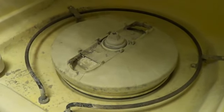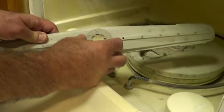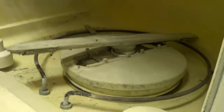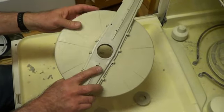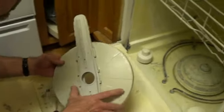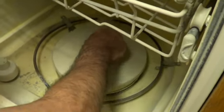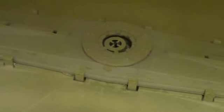Apparently there's no orientation there. I had done the extra step of undoing this but I don't think I had to, because basically the whole assembly is held on with this nut. We'll go ahead and get this snapped back into all these little fingers and get this nut tightened down. Got this snapped back in there. There's definitely a keyed way, so this only goes on one of two ways — it'll drop into the key.